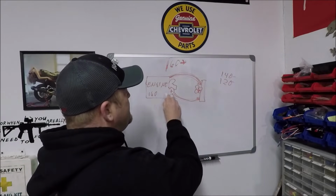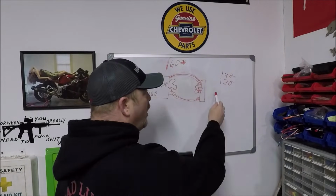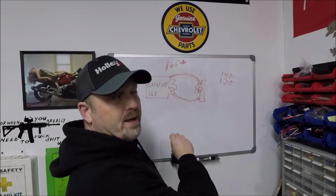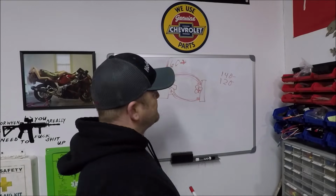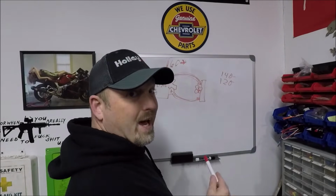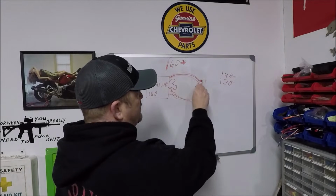If your cooling system cannot keep your engine at 160 degrees, then you probably shouldn't run a 160 degree thermostat, because what you could find happening, and again, this will be ambient air sensitive. In colder weather, it might be capable of maintaining 160 degrees. You get up to regular 75, 80 degree summer days, and you might start seeing that it runs a little warmer than that. It might start running 170, 180 degrees. That's a warning sign, because if you've got a 160 degree thermostat and it's 80 degrees outside, and you're already seeing 180 degrees in your engine temps, that's a warning sign that you don't want to be driving this car if you have a really hot day and it gets up to 95 or 100. Because what's going to happen is it's just going to get hotter and hotter, because the coolant is not going to stay in the radiator. The same problem we had with pulling the thermostat out altogether, and it's just gradually going to get hotter and hotter until it overheats.